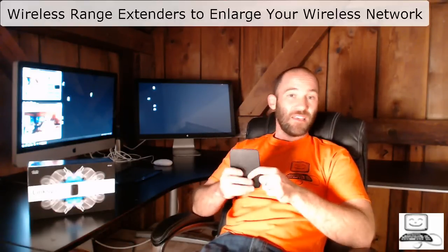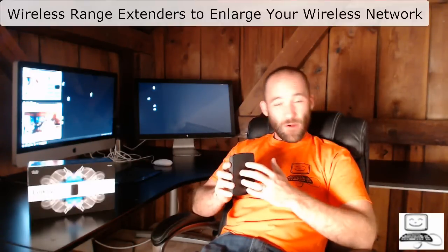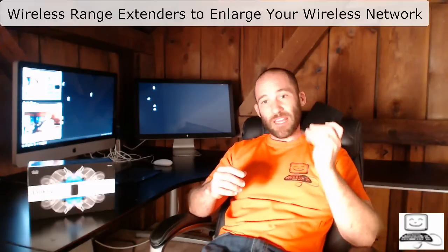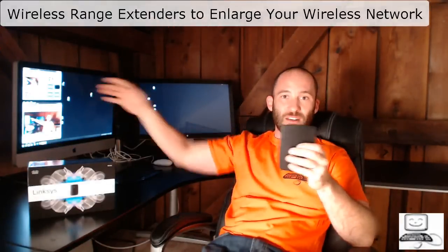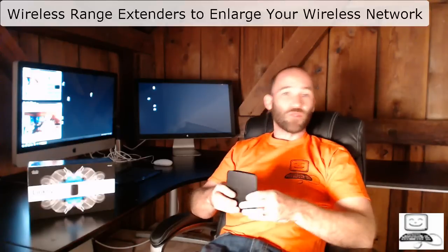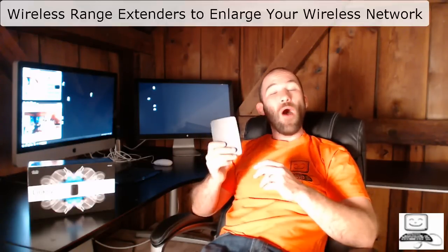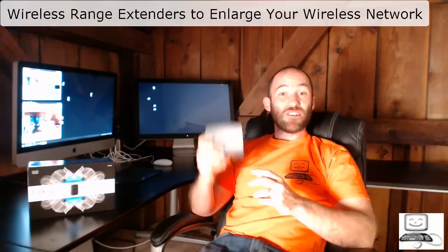If you don't particularly like Linksys, wireless range extenders are a standard type of technology. You can buy them from Netgear, D-Link, or Belkin. Essentially all you do is plug it in — as long as it can connect to a wireless signal, it will repeat that signal out and all your computers can connect to it. These new ones actually have traffic prioritization built in, and they have MIMO — multiple in, multiple out — meaning multiple antennas so they communicate better.